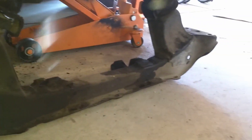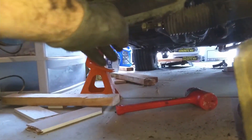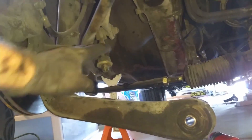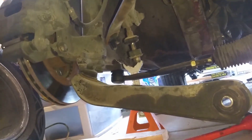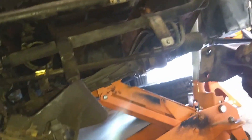There it is — off. It wasn't too difficult. There are a number of bolts but they came out pretty easy. I thought I was going to be able to just wiggle it around to get it out, but there are actually two bolts on this piece here and then one that goes on the sway bar, and that's on both the driver's side and the passenger side. I had to unhook those, and once I did, this little arm moves around pretty freely. Just be careful — the steering rack is just floating around at this point.